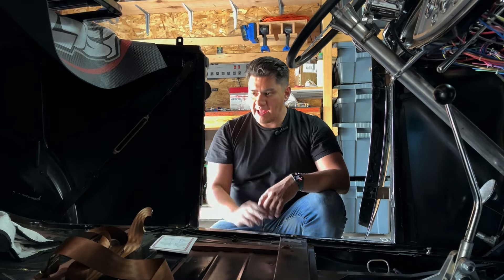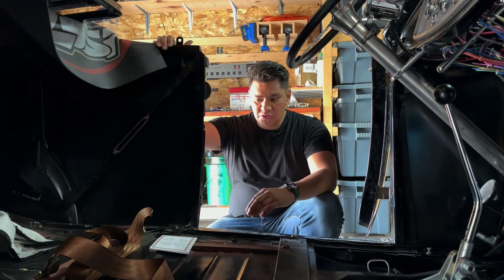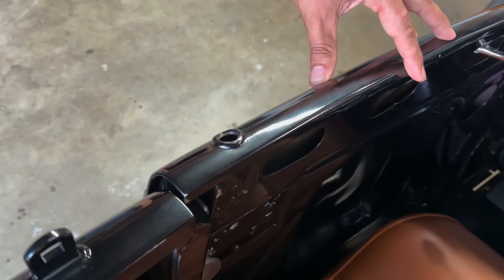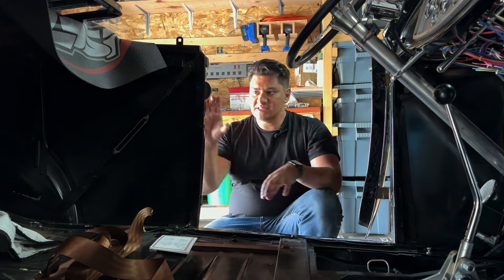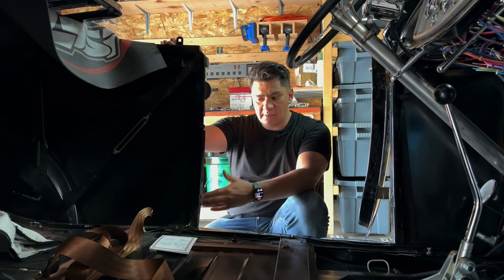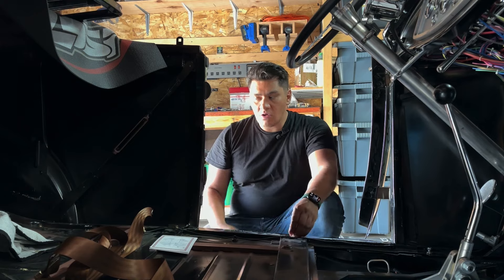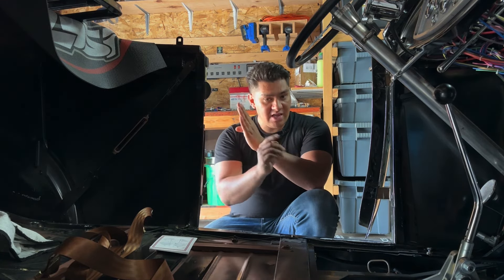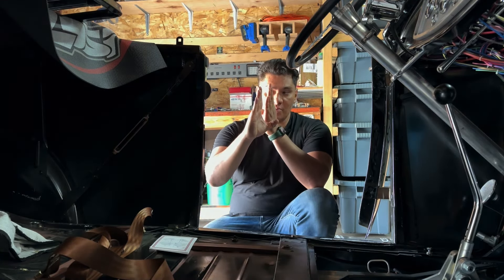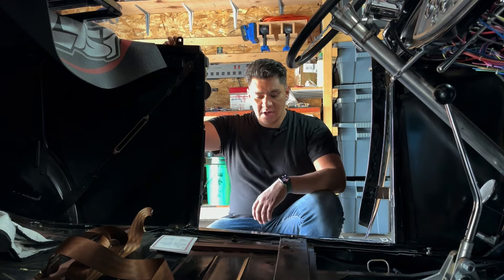That's how you're going to get a nice clean shutting door. Now that you understand what you're going for — a nice door gap and how the striker system should function — what I did is leave all these bolts loose, then closed the door lightly, just enough to see how the striker system is engaging. I'd tie in a single bolt and see what reaction happens, loosen that back up, tie in another one — just to learn how the body moves as you tie in different sections. The overall goal is to have your door gap close, with the final adjustment being that cow foot to bring it back open. As you tighten that final foot, since your hinges are here, it's going to make the door swing back out. It's all trial and error.